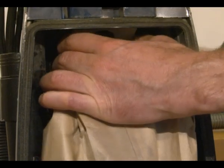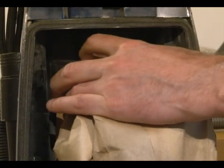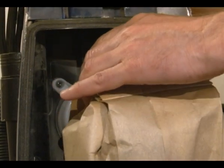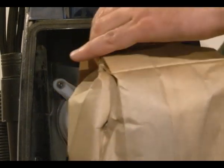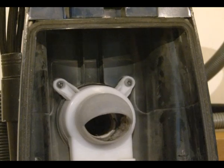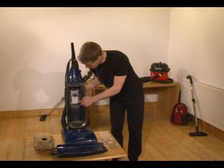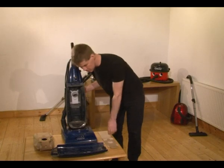They'll be connected to the rear of the machine with a cardboard collar. So you've got to look inside and disconnect that collar from where the air comes in, and just pull it out. It'll usually come out in an upwards direction. You can see the plastic assembly at the back here where the cardboard collar slides into.